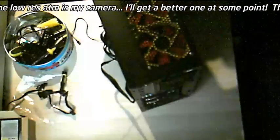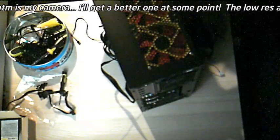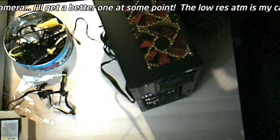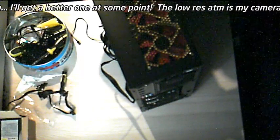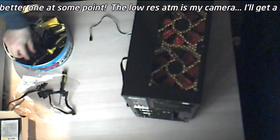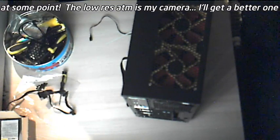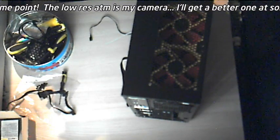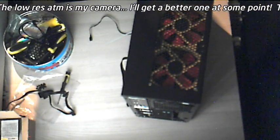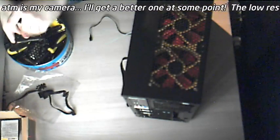Okay, I'm actually going to remanage this. So that drive's going in, second down, fan controller at the very top just to make wire management just that itty little bit easier. Okay, that's it. I'm also going to throw in a 2.5 inch drive. I'm just going to throw this little 120 gig Western Digital Scorpio in there if I can. Oh, it's just a simple screws-in mechanism. So cool. So I'm just going to mount it like an SSD. Use the bottom screws here. So just so you can see that.